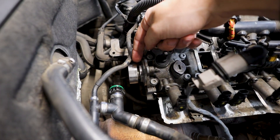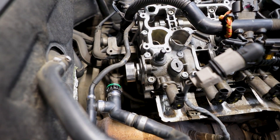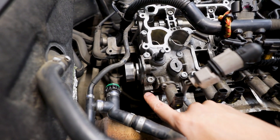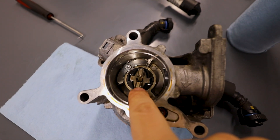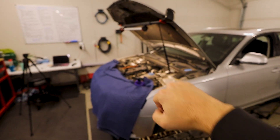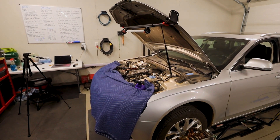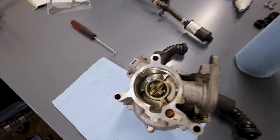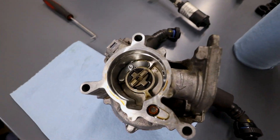To finish everything off I also installed the fresh o-ring down on our vacuum port. Heads up though — before you get excited and start putting things back on, make sure this mating surface on the back is really, really clean. You will find old pieces of the black crush gasket and you might even find some sealant squishing out between the cam cradle and the top of the head. Last thing: note the position of the key that's in the back of the vacuum pump, because you can just turn this with your fingers now. Look on the back of the cam and see what position it's in. You could manually turn the engine over if you really wanted to, but by far the easiest thing is to look at what position — say 11 o'clock, up and down — and clock the pump appropriately so that when you fit it onto the back of the head it just plops right into place.